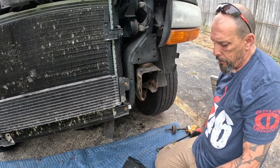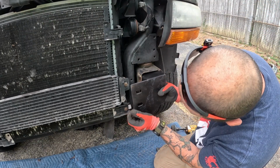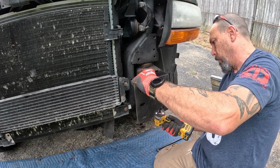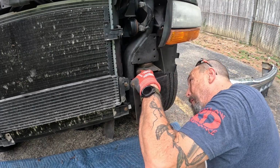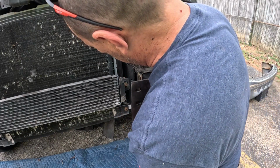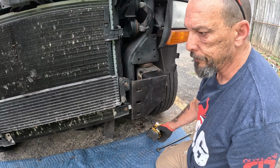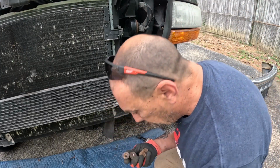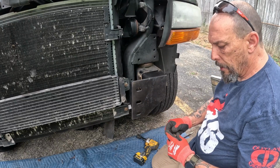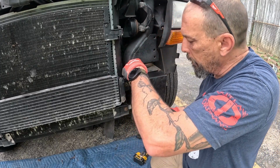Okay, so a 19 millimeter. Take your long bolt out, and then this goes in with the angle outwards. It goes in there, and then you can put your body mount bolt back in. Kind of have to wiggle it a little bit, but get it back in the hole. Just pull it up. I just move it around a little bit. Done. And then the nuts that I got from the setup that I got from taking the frame off, I'm gonna put the long part on the outside because there's 2 holes right here.